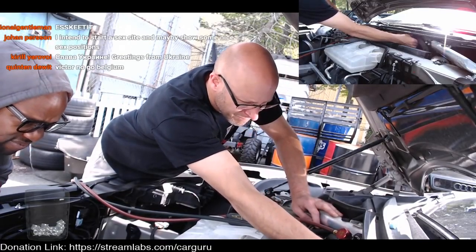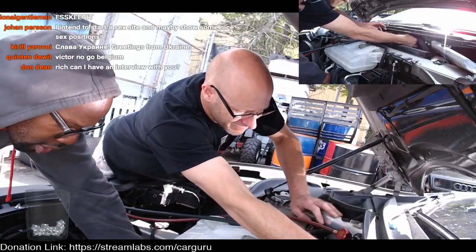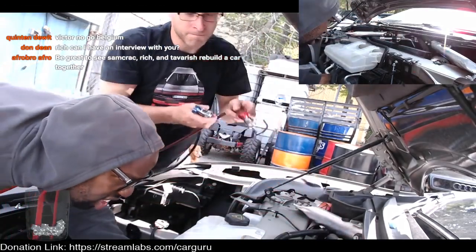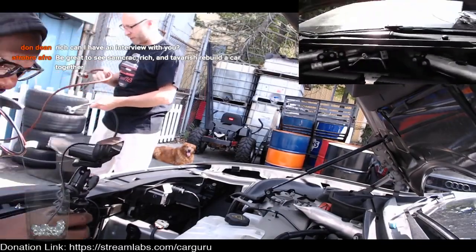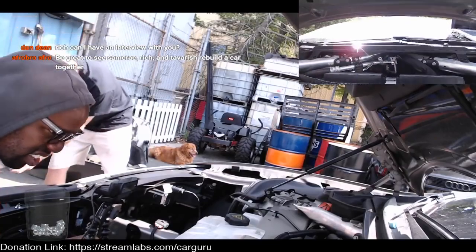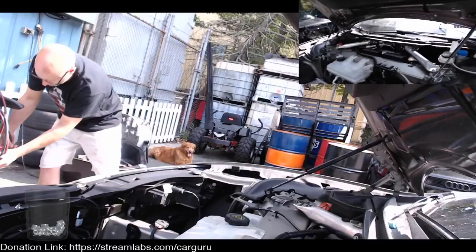Once Lee takes that off, you'll be able to see a little bit closer as to what else we've got to take off. Get that line out of here. There we go. Just to let you know, if anybody is a do-it-yourselfer, the low pressure line is very tight to fit in there to recover, or even get the line on there to do pressure measurements. But it will fit on. You don't need a special adapter.